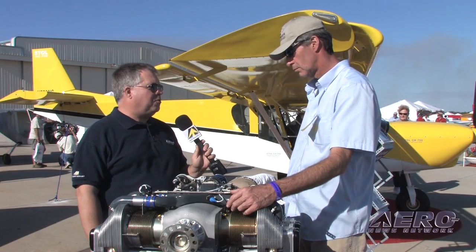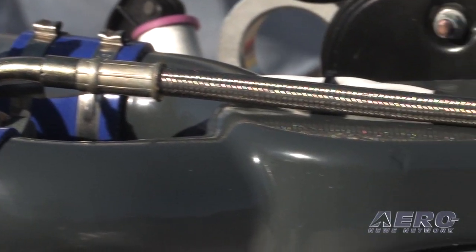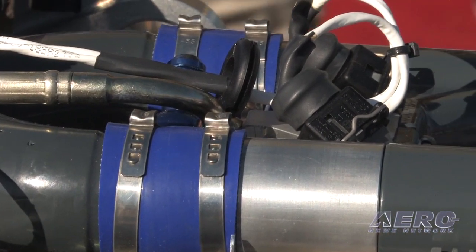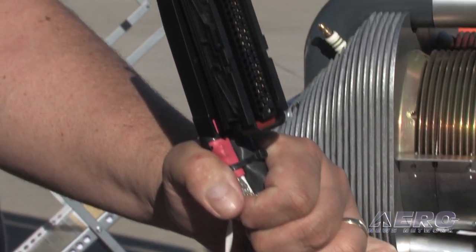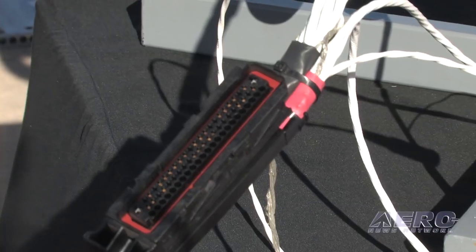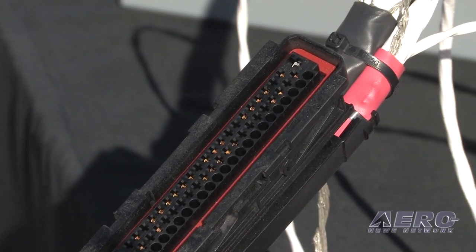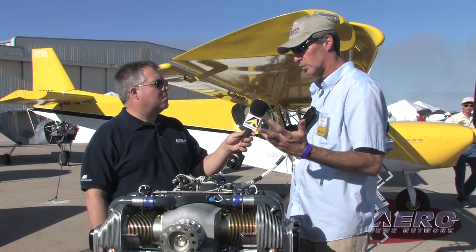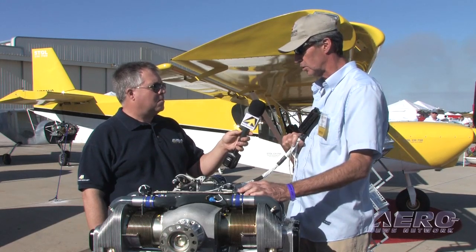What advantages does that bring to the Zenith and other LSAs? This engine is not only traditional aviation technology — air cooled and direct drive — but it's got multi-port fuel injection. There are four injectors close to the cylinders, so there's less chance of vapor lock. In the cockpit there's no primer because the injectors are right at the cylinders, so it's easier to start. There's no choke, and the engine has an ECU controlling the fuel-air mixture and ignition. Sensors send information to the ECU, which determines the correct fuel-air mixture and ignition timing. At low altitude cold start it knows to choke the engine; at high altitude hot start, it knows to lean the engine. All the way from startup to shutdown, the computer knows the most efficient fuel-air mixture and ignition timing.